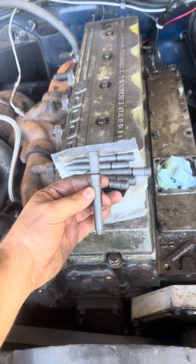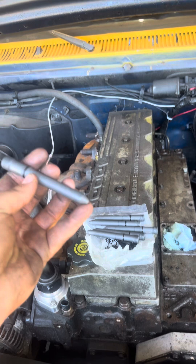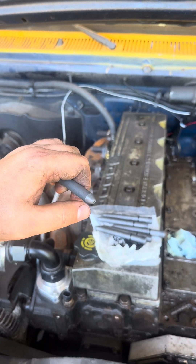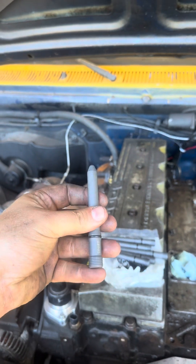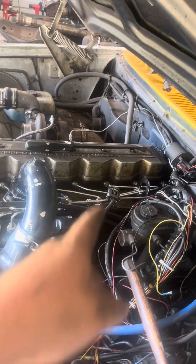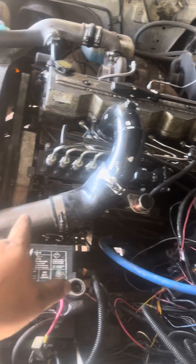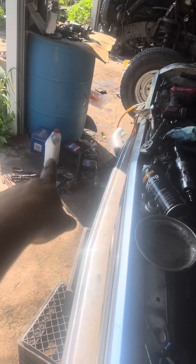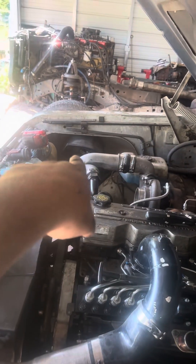Now the differential is done and I can finish putting everything back together. I got brand new injector connector tubes — that company had forgotten to send them. They say you can't reuse them, but technically you could machine a few thousandths of an inch off them on a lathe. I'm going to install the new set, then get the injector lines in, intake, and all the electrical back on. I also got to put a T in the fuel line for the pressure sensor and run those wires through the firewall into the dash.